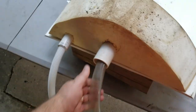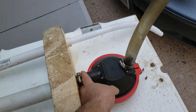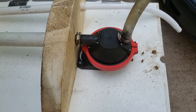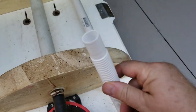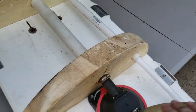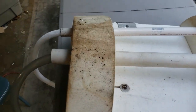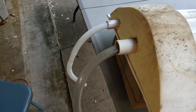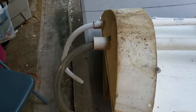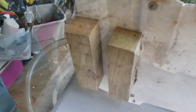Here's the underside of the rear floor. It already has the system for the factory bilge pump, but I had to run another PVC pipe for my electric bilge pump — one-inch PVC, drilled through and ran it out. This will go up to the through-hole with a petcock, and that should work out just fine.